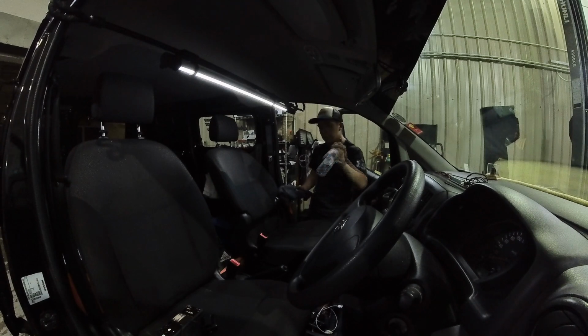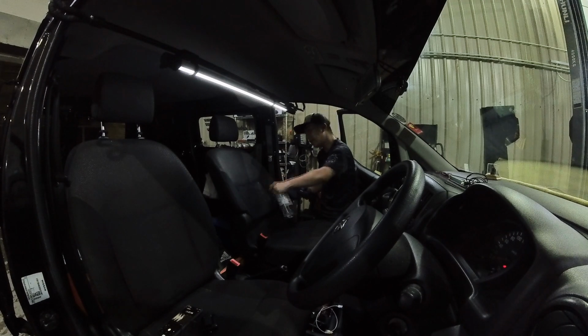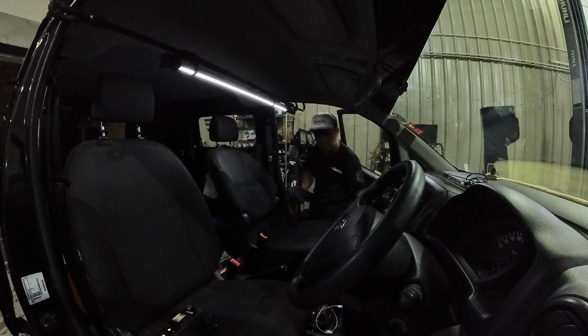Now, what we'll start first, we'll spray a generous amount of product. This is the SONAX Multi-Star that we recently purchased. It's an all-purpose cleaner. So we'll just wet the whole area with this Multi-Star. The purpose of it is to add more cleaning agents to the whole process. You want the steam cleaner, the heat, to lift up the dirt and grime with the help of this Multi-Star.